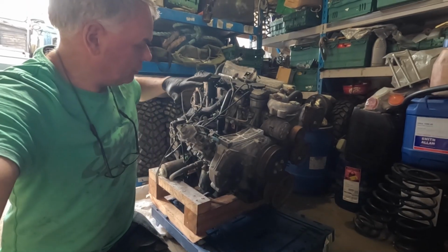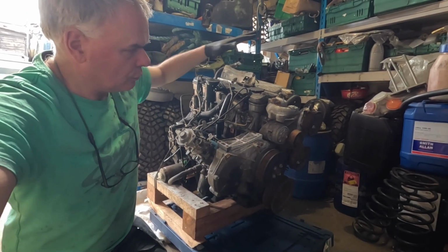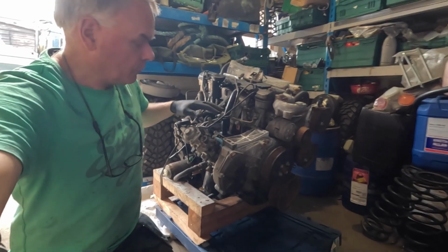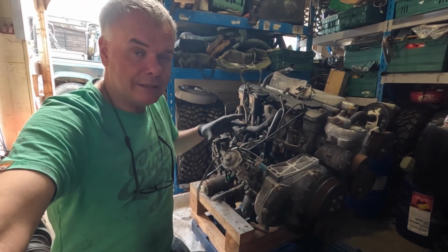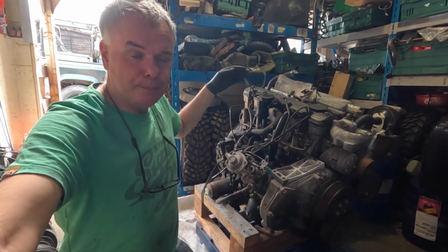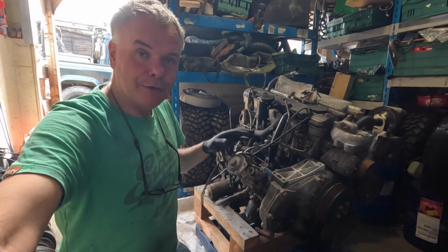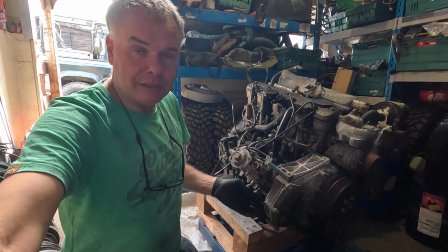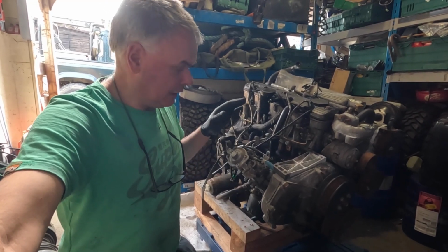The other thing I need to do is make sure, when this is all set up, top dead centre on compression, front and rear, that I then lock the pump off, so that when I remove the pump it still maintains its setting, and then I should be able to just put it on the other engine, which will also be set up on top dead centre, and it should just work. It should. And there is a locking tab on the back of this, so you can lock this and then remove it and put it back in and then unlock it again.